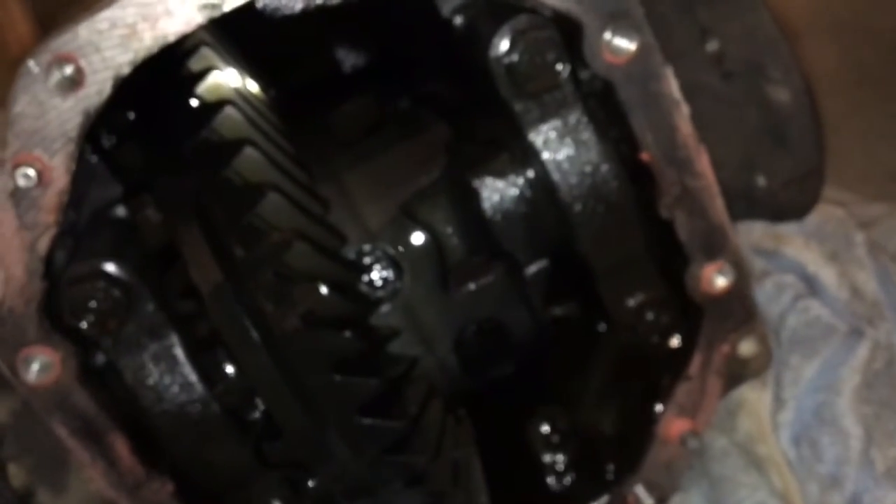You can see that little bit of paint there. I did the same thing there, so this has 11 teeth on the pinion and 43 on the crown wheel, which gives me a 3.909 ratio.